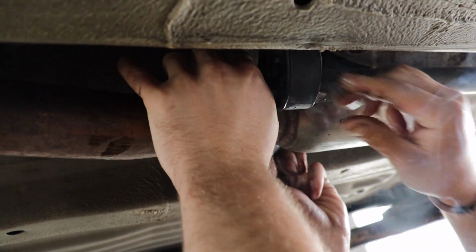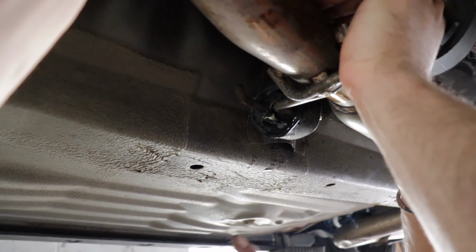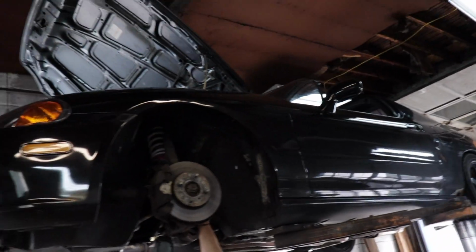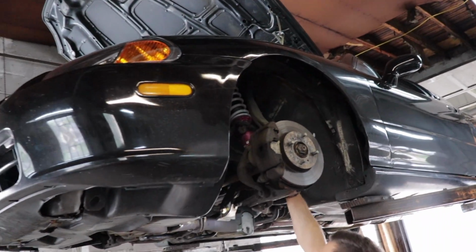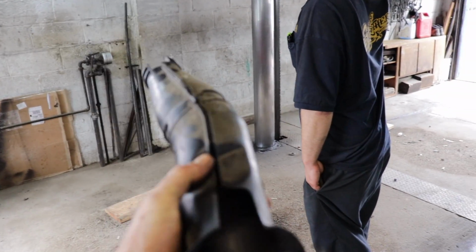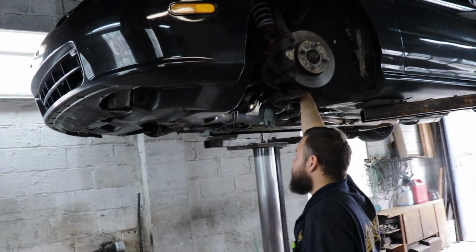Oh, you're gonna have to come up. There you go. Thank you. Bingo. All right, so the only thing other than to do is to tighten up the bolt and the steering linkage under the dash, and then put the boot back on, which is pretty self-explanatory. Wrap it around and then throw the clips back on it. But that wraps up the rack.